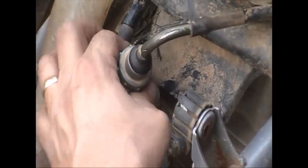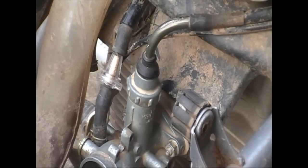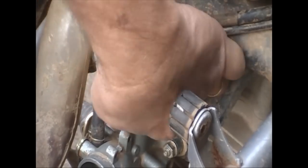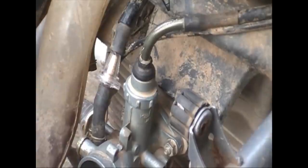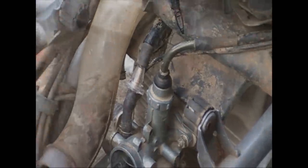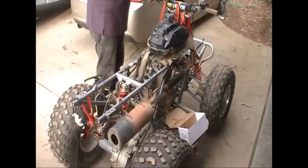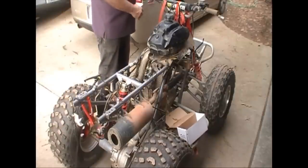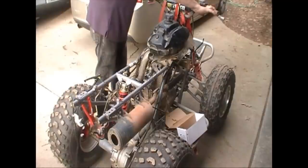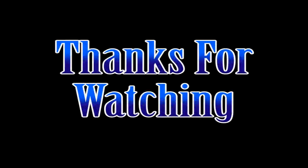When you put your slide back in, just spin it — there's a notch that it will slide down; it won't go down until you have it in the right spot. Tighten the cap — we already attached the throttle cable. Turn your petcock open, then open your drain screw until gas comes out the overflow hose, then close the screw back up. That will help make sure the carburetor bowl is full of gas and ready to start. It wouldn't run at all when we first started — success! Not that big of a project. Thanks for watching.